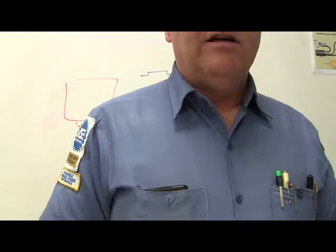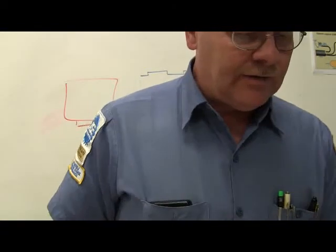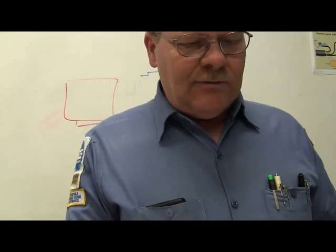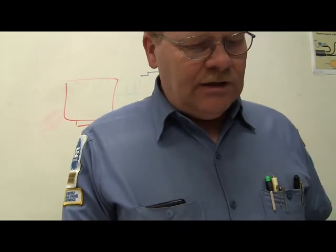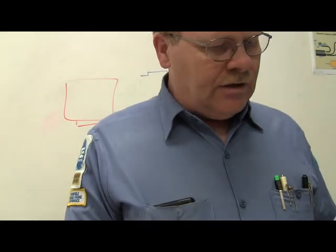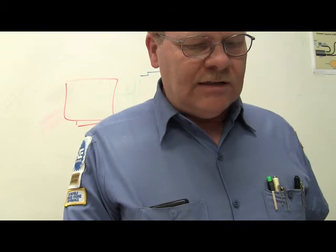Now, y'all went over to the transmission shop. He just put straight old shop air in there, didn't he, Webb? Just pure old 100-pound shop air, whatever, 150. Number 7, the solenoid pressure switch assembly has been upgraded for the 2000 model year. How can you tell if a 41TE transaxle has the upgraded unit or the previous version? And number 7, that's the sound shield and separator plate are not used with the revised assembly.